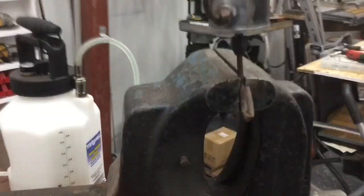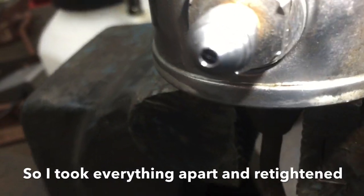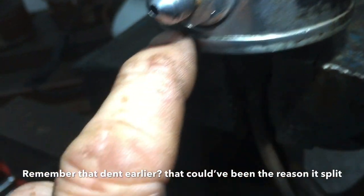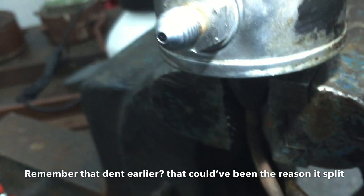Unfortunately I have to take the bottom one out to fix the side one. Okay, so I still have a leak, but I noticed it is not on the fitting — you can see right in the seam of the can where the can was soldered that there's a little tiny crack. So I'm going to clean that out really good, take my torch with a little bit of solder, just heat that up and see if I can feed just a little bit of flux and solder in there to seal that back up.